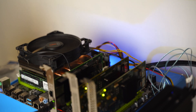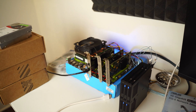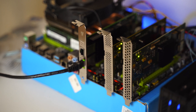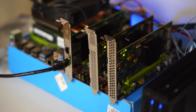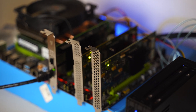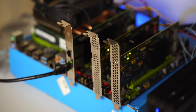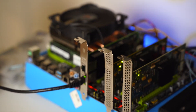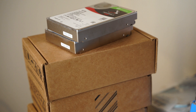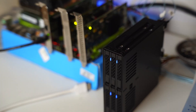All of this is currently being powered by a cheapo Pico power supply, though that's not the final power supply — there's a 1000 watt power supply inside the case we'll get to in a moment. On top of the motherboard you'll notice a number of cards: this is an Intel 10 gigabit ethernet copper card, because we are going to be connecting through 10 gigabit — we might also do some link aggregation, so there are two ports. Then we have two LSI RAID cards, both capable of carrying up to eight disks, so we're putting a total of 16 disks inside the server. For drives, we're using IronWolf 6 terabyte hard drives.